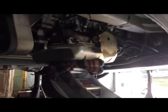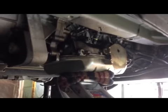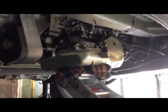Put something on top of whatever you're supporting it with, because basically the pan is not that strong and you don't want to bend it or scratch it or make dents or anything else that can damage it. You know what, I'm probably going to do something else that will support the transmission in a different place as well, because I don't like putting too much pressure there.